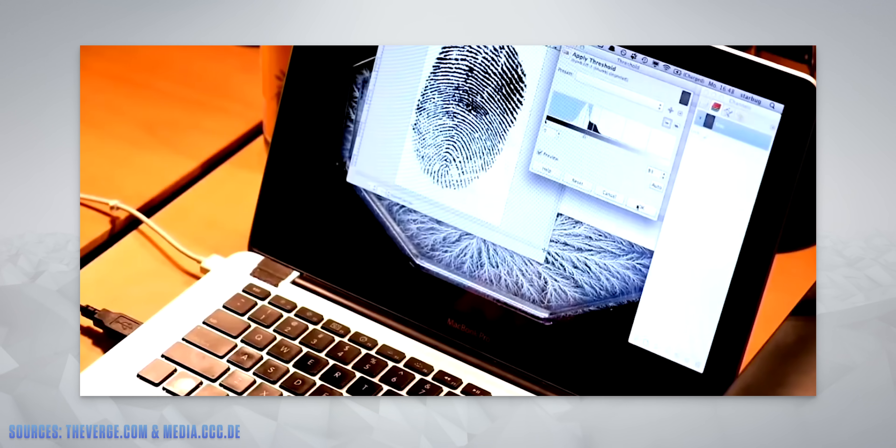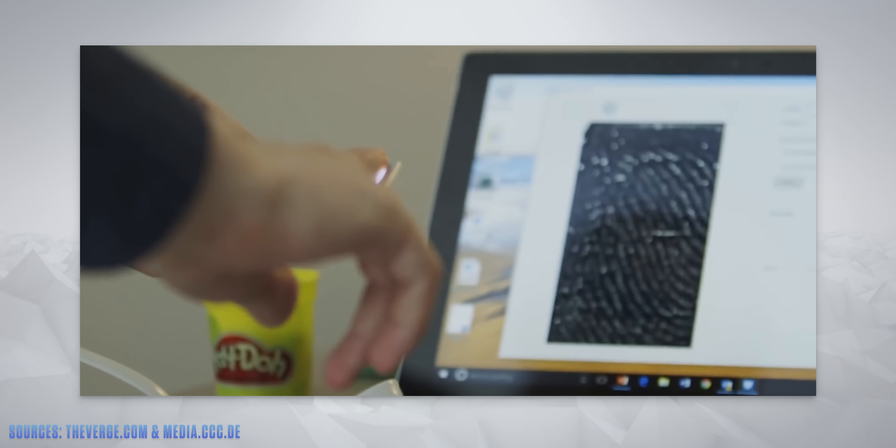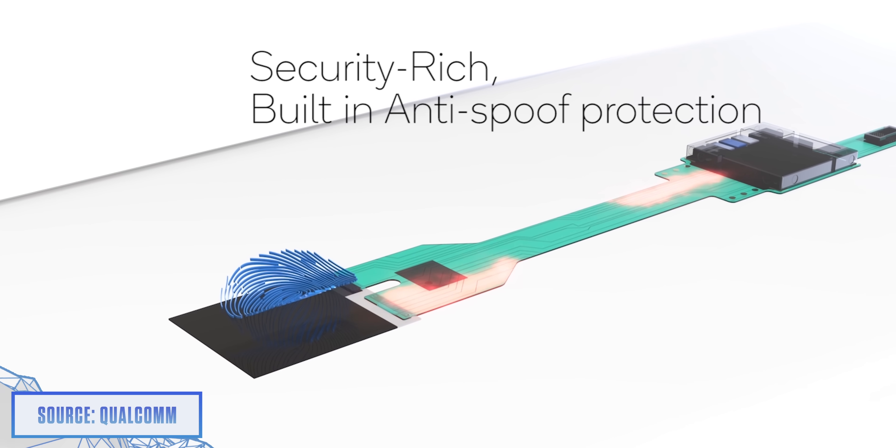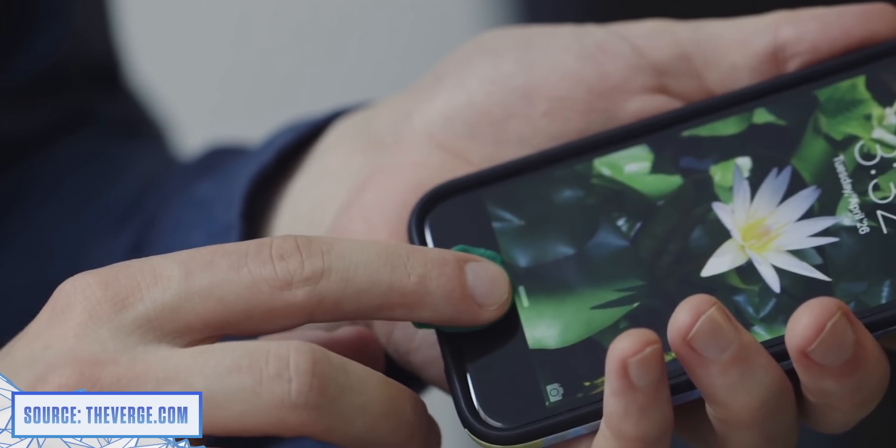Security-wise, ultrasonic is just much harder to bypass. With a 2D scanner, you could take a photograph of someone's print or a sample of the oily residue on their screen, and this would actually be enough to get in. But if depth is also being detected, that wouldn't work. Qualcomm has built three-dimensional anti-spoofing capability, training the sensor to understand the properties of real skin — like its elasticity — so even if someone managed to build a 3D mockup of your finger, it still wouldn't work.